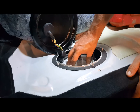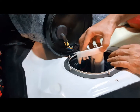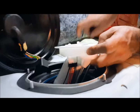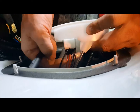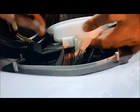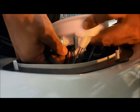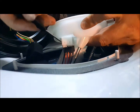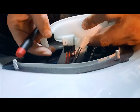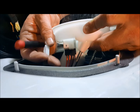Now that we've got the lock ring removed, we're going to want to let the pump assembly come up. This is kind of spring-loaded so it's going to naturally lift up. You'll find right here are the wires that go over to the float assembly on the driver's side of the car. You're going to have to remove those — push in on the little tab here and pull down. It can be a little tight, so get that pushed in good and then pull down. It's just a little clip that gets pushed back.